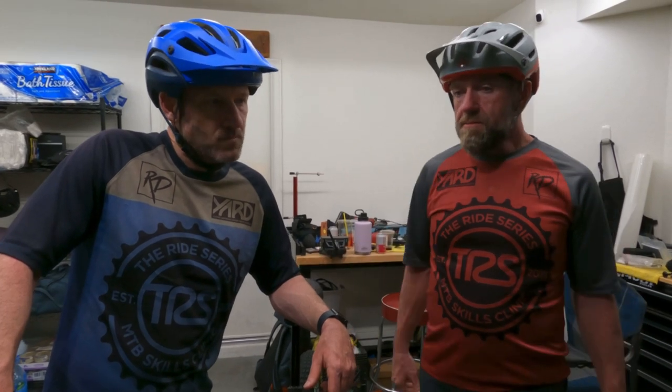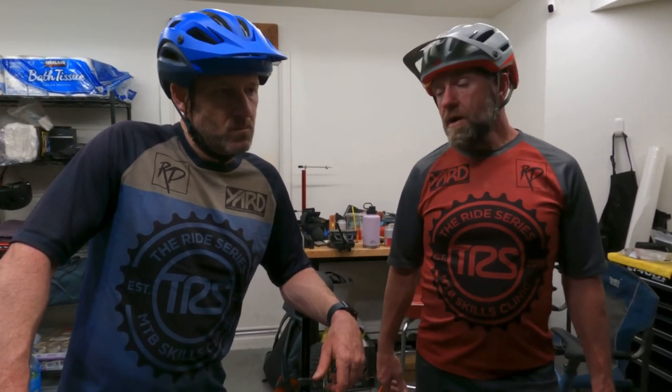So I think I would probably try an angle set in it, take some of the head angle out, because I don't think it needs that. The wheelbase is long enough for the stability. I think that would make it handle better here where I ride. And I'm just bummed that I didn't get a chance to turn her loose, the Purple People Eater.